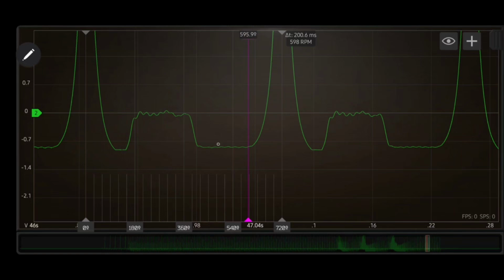Now whether that's because this valve is opening too late, or shutting too early, or shutting too late, whatever the situation may be, we definitely have some leaking going on here. What I'm guessing is the overlap time between the exhaust shutting and the intake opening is too far, so we're not getting as much vacuum as we should on the downstroke in order to build compression again. So before we hit bottom dead center, between top dead center and bottom dead center, we're not getting enough time in there.